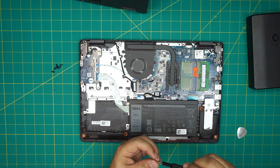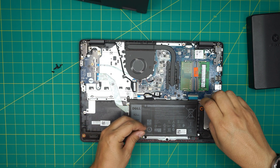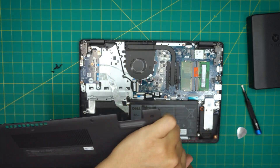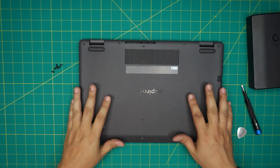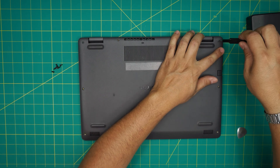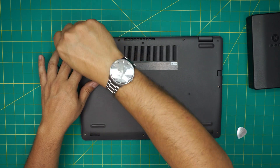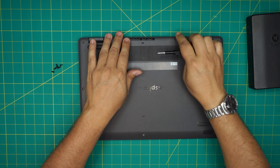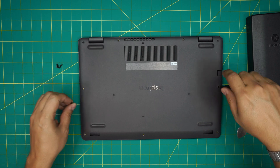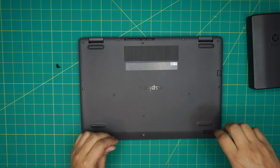Once powered on, the laptop might take five to ten seconds to boot up, so don't panic — just be patient and it will load normally. Once the screws are in, grab the bottom cover, place it on top, and squeeze it down. Make sure it clicks. Don't push down the corners — just tighten up the screws and it will pull itself back into place. Do the left and right side screws. If you have any questions or requests, leave them in the comments. Thanks for watching!